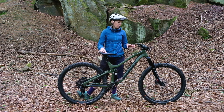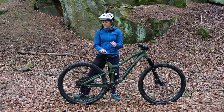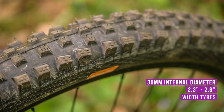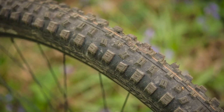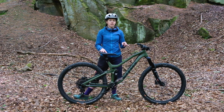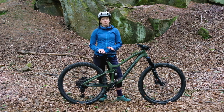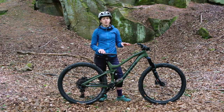With regards to wheels and tyres, it's a half-decent width of rim — the STi30s have a 30mm internal width. They've got 2.35-inch tyres, but that width of rim sets you up to run wider tyres in the future. These are the orange-label Addix compound — the soft compound from Schwalbe — which is great front and rear. The only thing to be aware of is that they're the Snakeskin sidewall, which is a little thinner than Super Gravity, so you might be a little more prone to punctures if riding hard. But in terms of compound and tread pattern, these are ideal for UK winter slop.